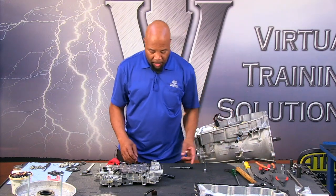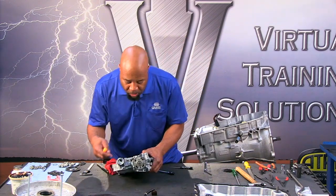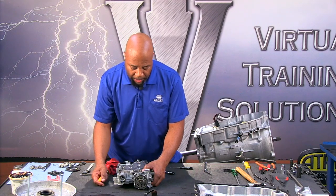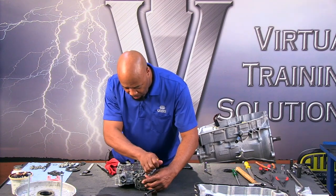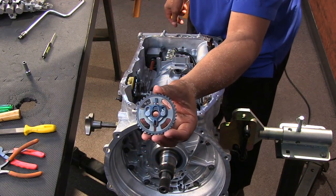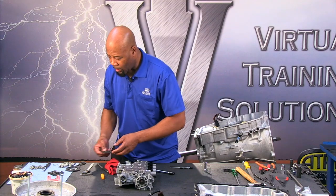If you were removing the gear with the pump cover on, let me show you that quickly. There is a portion at the 12 o'clock position where the actual clip can be accessed from the backside. If you have small fingers, you can get in there and get the chain off — but it really is a pain. You can do it though: just pull it back towards you and then pull it up, and it pops right off. You can also use a scribe — get underneath there, hook it, and pull it back. Half a dozen in one hand, six in the other — whatever works for you.